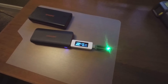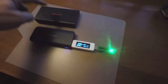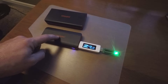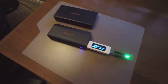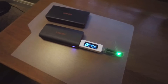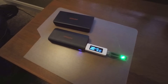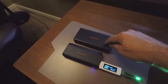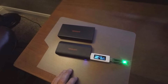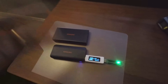9,810 milliamp hours. This is the result from the 15,000 milliamp hour pack — one third less than its stated capacity. This is a 10,000 milliamp hour pack, so if it's the same ratio, it'll be one third less than this — maybe about 6,500 milliamp hours is all this one will put out. Having this pack at only two thirds of its rated capacity, I do not pass this power bank. I have another one, so I'm going to test that. If it's the same, I won't bother with it; if it's different, I'll update the video.